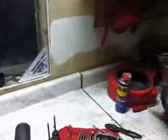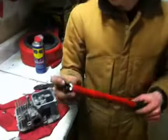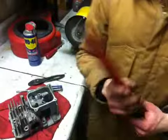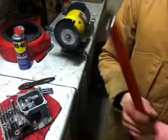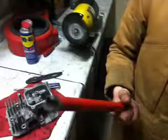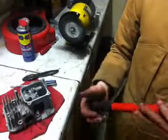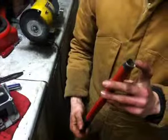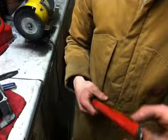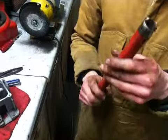This is a really interesting tool that I made - you can see there's a cut right here. What this is is actually a valve removal tool. It's not as easy to use as valve spring compressors, but if you don't have one, you can make one. I used a piece of three-quarter inch pipe and just cut a notch in it. You want steel pipe and you can usually find them laying around.